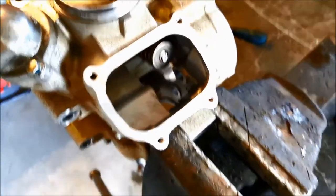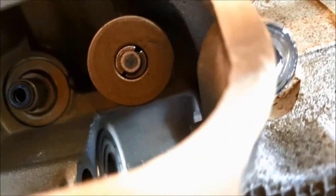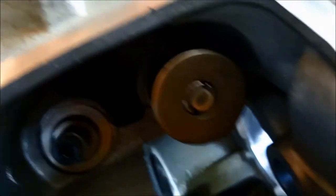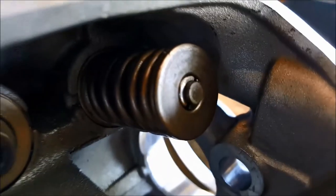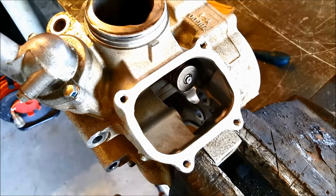The collets are now correctly mounted with near enough an even gap. So the first of the intake valves is now installed — the spring, the collets and the cap. You can see the position of the valve stem oil seals now as well. The valve is in, and there's no need to lap this valve as we've not changed anything from how it was before.